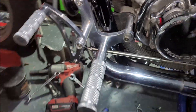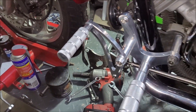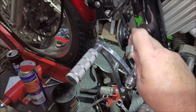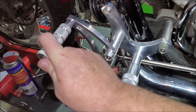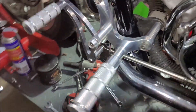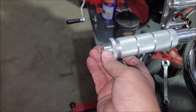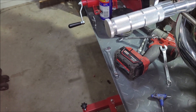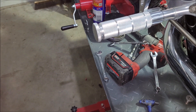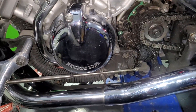So what we ended up doing — as I mentioned, I removed this spacer from the top and cut that much off that spacer. Everything seems to line up and work. I wasn't happy with how much this stuck out so I cut again — I think that's about 20mm off the end of that. Maybe I could cut more but for now I'll leave it. I just got to put this side case back on and then we'll start on the other side.